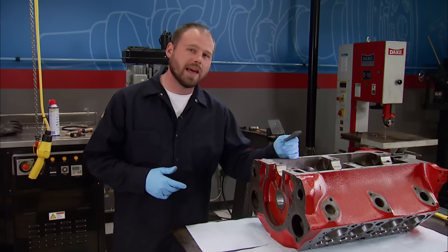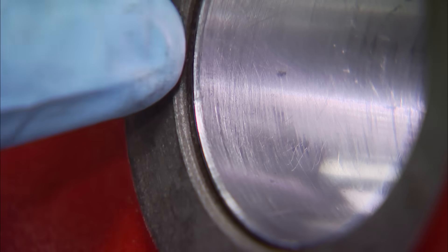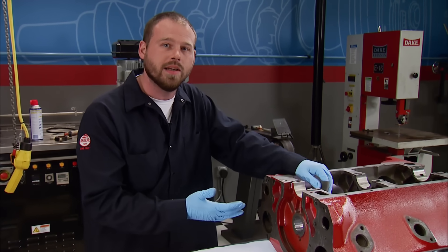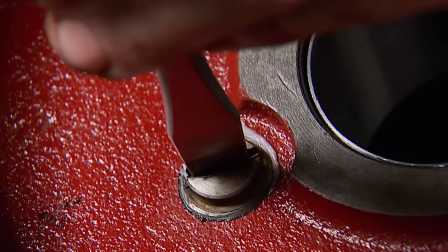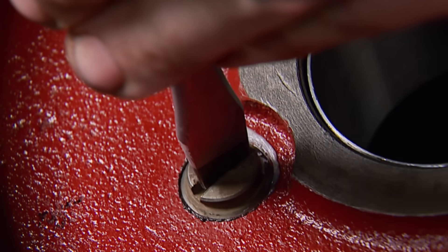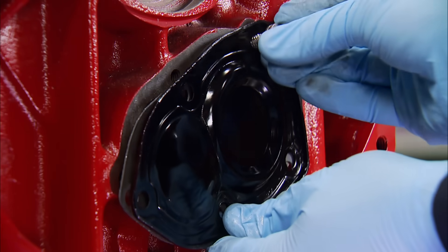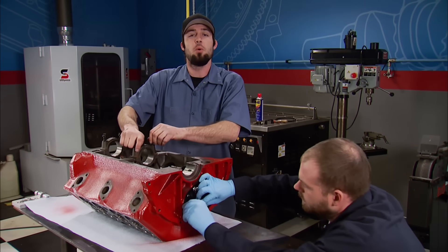Installing cam bearings and test fitting camshafts can be pretty intimidating — a lot of guys no matter how slow or soft they try to put them in always end up with some nicks. Well, I do too, and it's not that big of a deal. The bearing is a lot stronger than you think, but if they bother you, I'll show you a little trick: with some light pressure and a little gray Scotch-Brite, just rub it till it cleans up. Flatheads only use one oil galley plug — it's located at the front of the engine. Out back, the new idler gear for the oil pump can be installed and covered with the factory piece. Parts are starting to trickle in, and when we get our list checked off, we'll continue the build of this historic V8 that started the hot rodding craze.